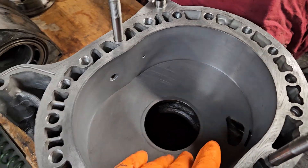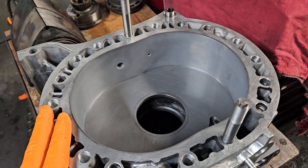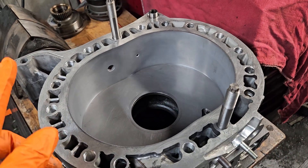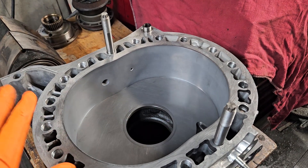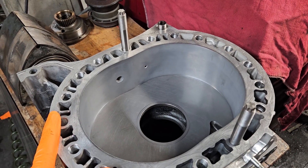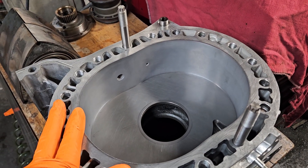Full bridge, fully studded, performance build. Balanced, probably lightweight rotors. We were associated with the machine work on this build probably five or six years ago. So that motor's been together, running happily. It was on the dyno — they were trying to push the limits. They lost compression. So even though that motor had been happy and together for a long time, sometimes you get power hungry, something goes awry.